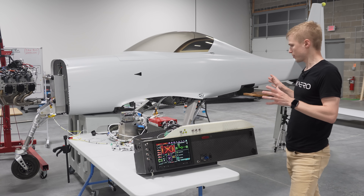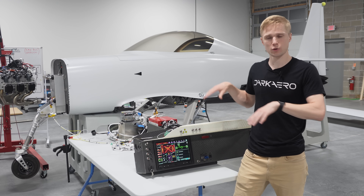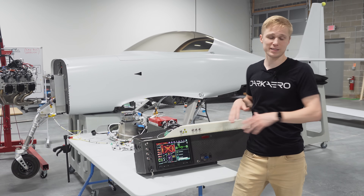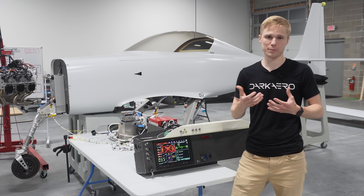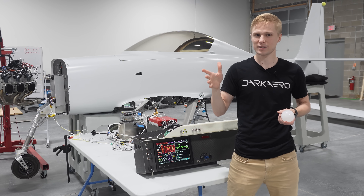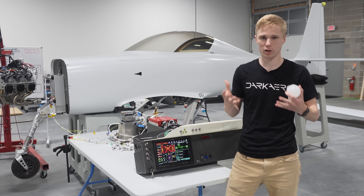You'll notice that this time around they moved a little quicker going down, and that's just because we had gravity working in our favor. As we ran this test, the total amount of power that our retract system drew was only around 100 watts. One thing that is counterintuitive about retractable landing gear is the surprisingly small amount of power required to accomplish the retract motion. Everyone is familiar with a 100-watt light bulb, but what does 100 watts feel like? If you hop on a bicycle and pedal lightly, that is roughly 100 watts. In the RC world, many 100-watt motors exist that are about the size of a walnut.